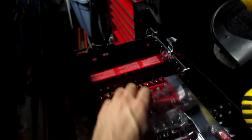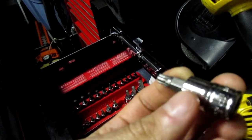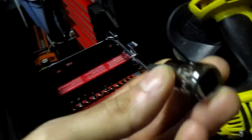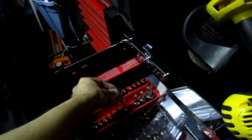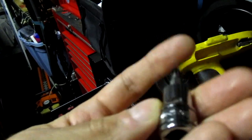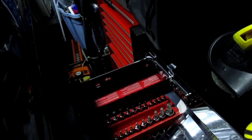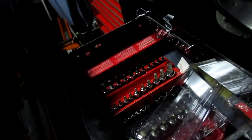As we go to the cramped condo garage — this place sucks — and back to playing with tools. There's my Torx plus. We got this today. Torx plus is different from standard Torx. 1999 to present, a lot of vehicles use Torx plus. Didn't want to buy a cheap set so we got Snap-on. Brand new — $414 list — I did not even pay half of that. They were on it like hotcakes. And that's standard Torx. Snap-on rules.